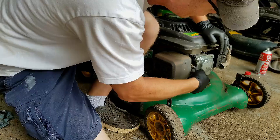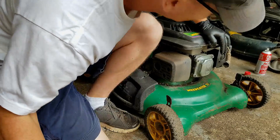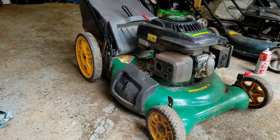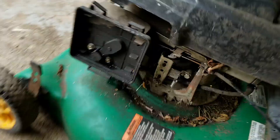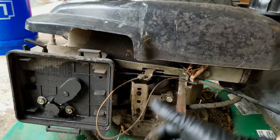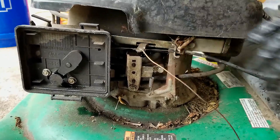We're going to pull the spark plug out here now. It doesn't smell very much like gas. Another restriction that could be happening is that the brake is still engaged. Here's our brake cable — take a look here. It is rusty and snapped off. So that's not disengaging this brake right here, which is causing it to be hard to pull over. I see a lot of these brake cables that break off the same exact way. They're left outside, they get rusty, and snap off once you put some pressure on them.